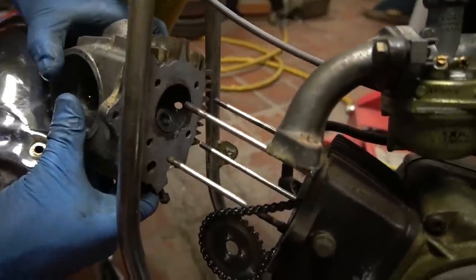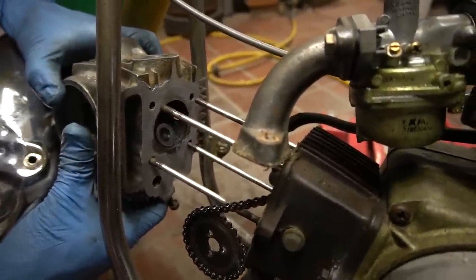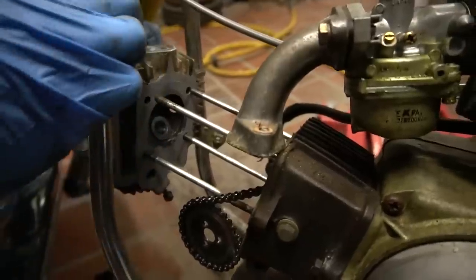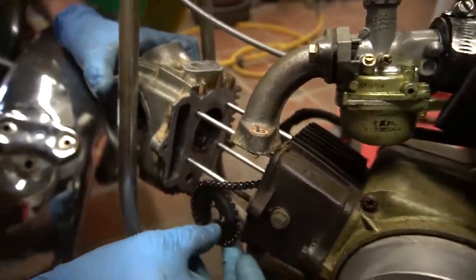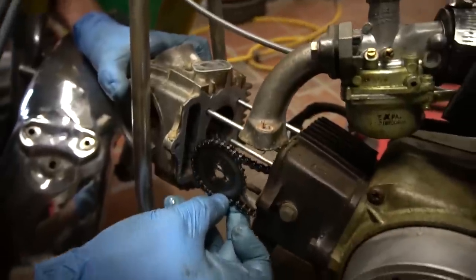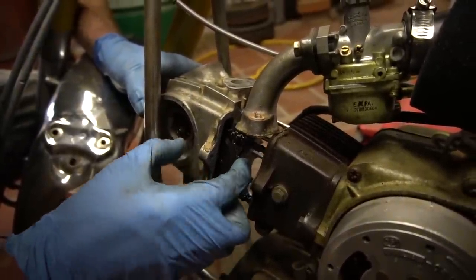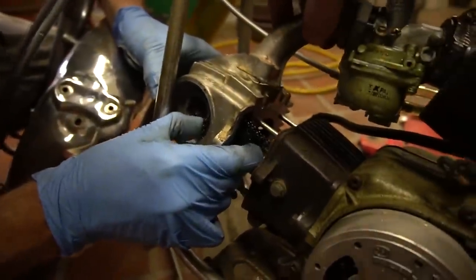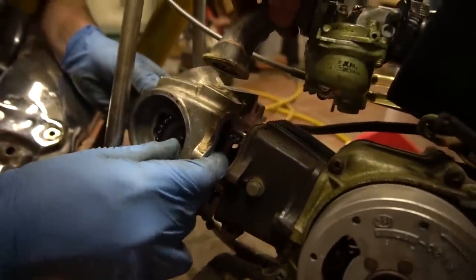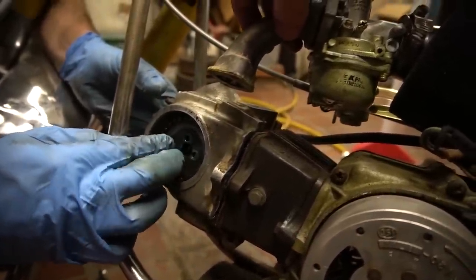Normally, I would tell people not to use silicone on head gaskets. Use the copper gasket maker. But we don't have it here. And we want this now. So, and this is, again, temporary, because we are going with hopefully 140s.